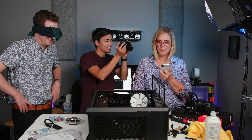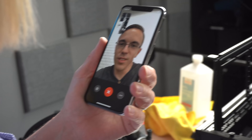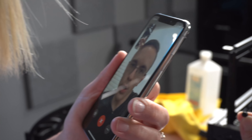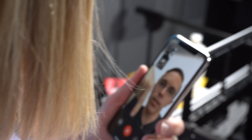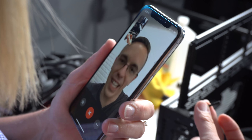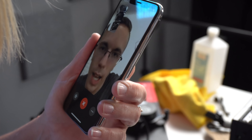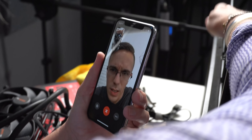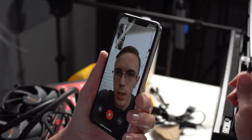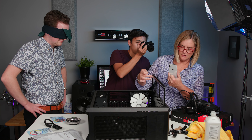Quinn, I can handle the water block — just tell her what screws to mount the rad to the top of the case. You should have some fairly long screws that go through the top, through the fans. You need to put the screw through the fans into the radiator and then into the case. See the two rails above — the long holes? That's where the screws need to go. Best of luck! Thanks, Austin.